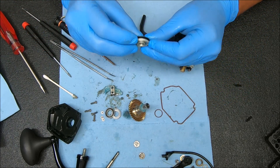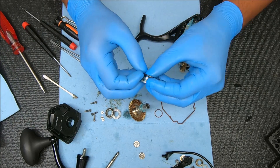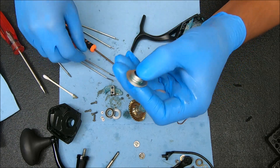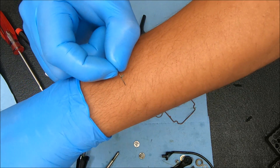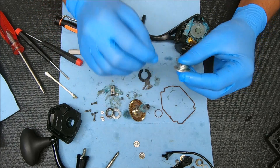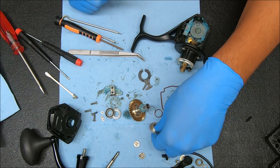I don't always take this off, but I'll take it off so you can see it. This one's a little tricky because you have to kind of open it up and pull up at the same time. Notice that there's a spring under there — we'll take that off as well. On that spring there's a raised end right there; that raised end will be facing up. So the larger part of the top is where the ring will sit, facing up, and this part faces down towards the pinion.